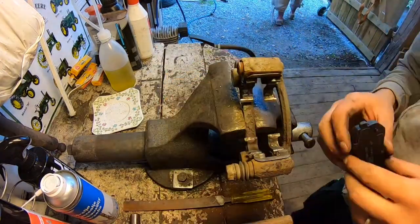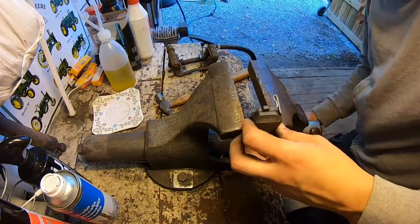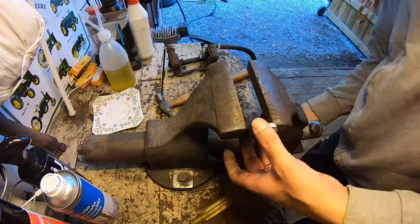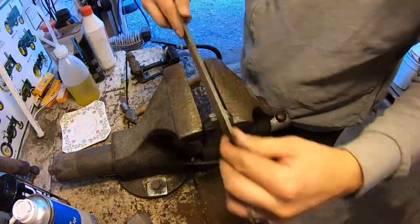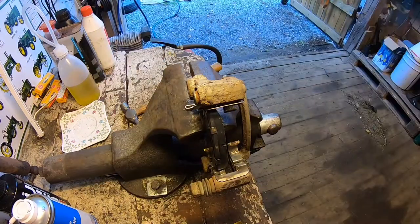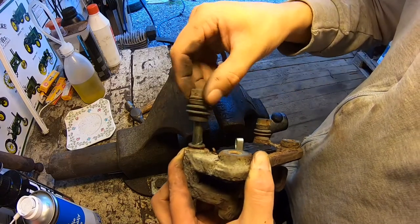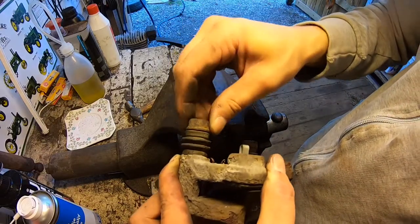Install the pad clips, install the pads, and make sure they can move freely. If you're not using OEM pads, you might have to file them down a bit to make them run easy in the pad clips. Use ceramic grease or copper paste on the pad contact points. You should use a silicone grease for these glide pins — they should move quite easily.